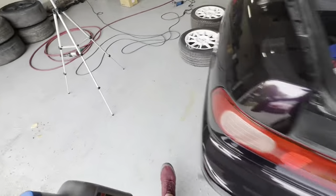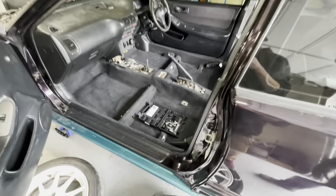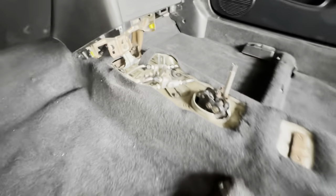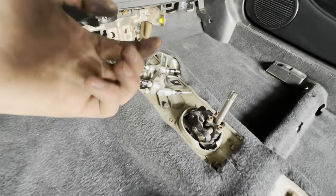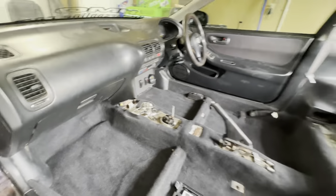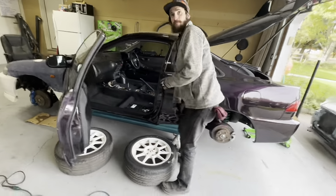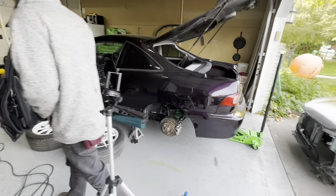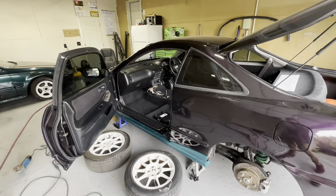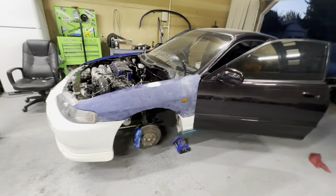The previous owner had a tucked brake line kit throughout the inside of the chassis. He put the proportioning valve right here, and I found a leak at this fitting — me and Brian had to re-flare that today. When bleeding brakes, you want to start at the furthest wheel away from the master cylinder. With this being right-hand drive, we're going to start on the passenger rear, left rear.